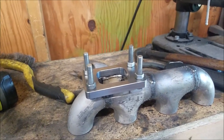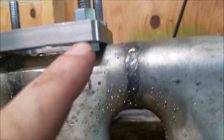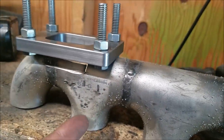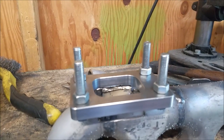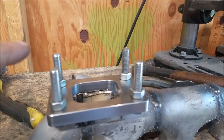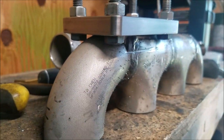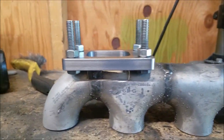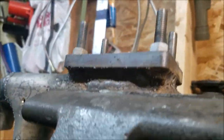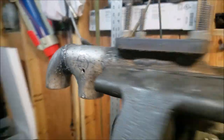So here's Paul's brilliant idea — I do not condone this idea, I know it's gonna come back to bite him. There are bolts going through this way, and basically I'm gonna run a bead all the way around so it acts like it has studs. These aren't even stainless, they're not grade eight — they're cheapies. There are gaps to fill; it's not the greatest fitment. Well, there it is welded on — looks like shit. I almost made a nice-looking manifold and then this happened.